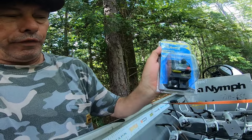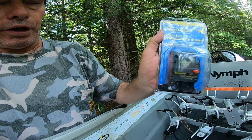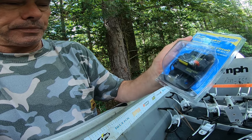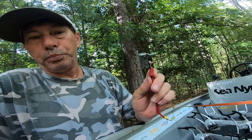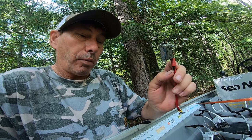I've got a 60-amp breaker with a manual reset. When it trips, you've got to manually press the red button to reset it. The automatic one would just push juice back up the cable as soon as it cleared, which if you're having problems is just going to create more trouble.